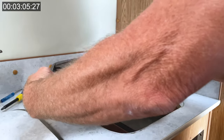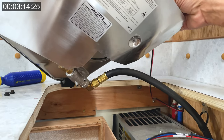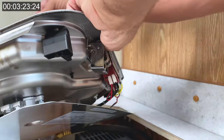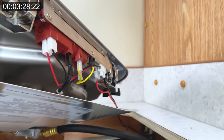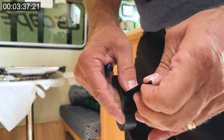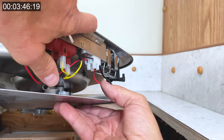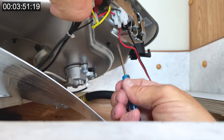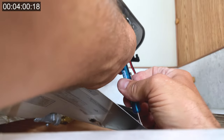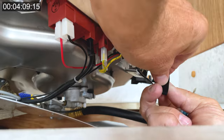We're going to have a gas line here on this side — it's kind of a bear to get at on these little ones. Then we've got a positive and a negative wire that we'll take out; that's for the igniter. I'll take that out first. I have a little electrician's tape to put on the positive side — the red wire — because if that grounds out you'll blow a fuse. So if it doesn't spark once you get it all hooked back up, check your fuses. Those will just slip out once you get it undone. There's my positive wire — taping it up so it doesn't short out.